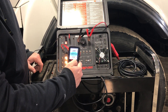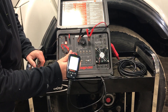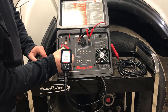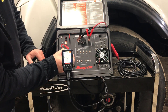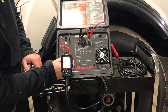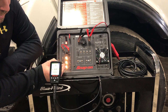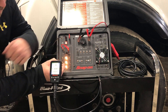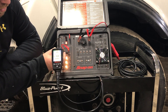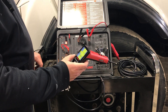Now we're going to look for amps. Hit menu, come over here and test. You hit the positive button on the positive side of your connector and it gives you a whole bunch of readings — it'll tell you how many ohms and how many amps this little light is using. Then you come over to the ground, hit the ground button, and it tells you the resistance and how many amps are going back through the ground.